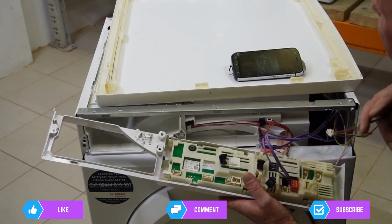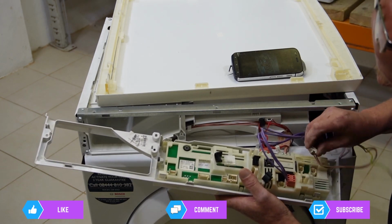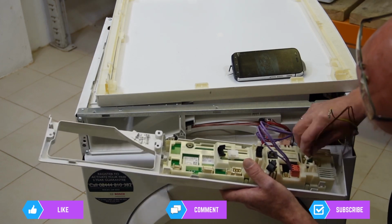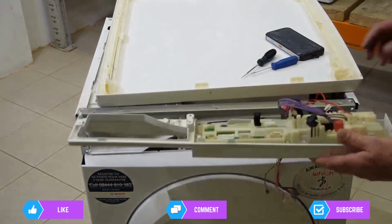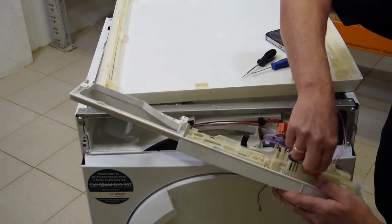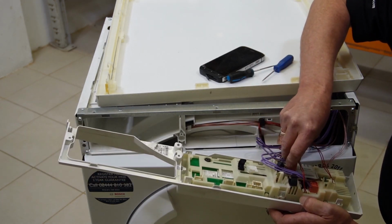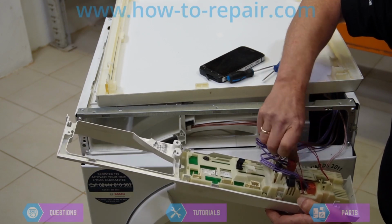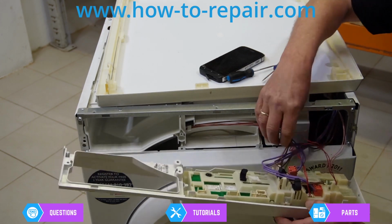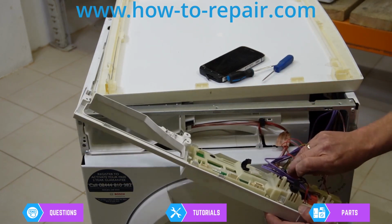that we're looking for a brown wire, and that goes on to that one, and you can see the lugs there. So I just need to put that one into that location. Next, according to the photograph, this is a double red with two outside lugs, and that is correct. That goes into there. That must be the double purple. I had the plug the wrong way round, sorry. So that needs to come round because it's going to go under the wiring loop there, and that lives in that one.